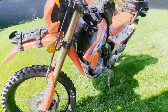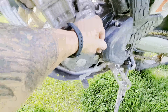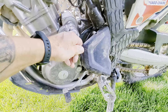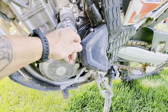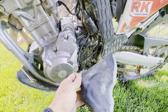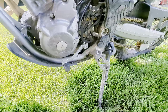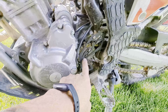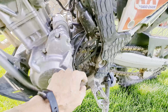So now let's move on to the next accessory. When we're riding, there's a chain cover here that usually covers the front drive sprocket, and basically it doesn't allow you to see what's going on inside. There are only two 8-millimeter bolts to take out to access this cover, which is pretty easy to do. But let's face it, guys — the majority of us are not going to pull this cover off to inspect the sprocket all the time. What I found was that this cover holds mud when you're riding, and because it holds the mud, it tends to pack it into the gearing inside. This really packs up your drive sprocket with mud.